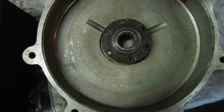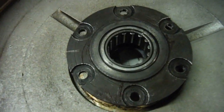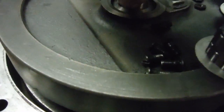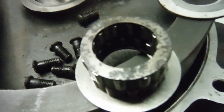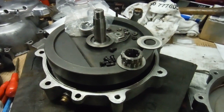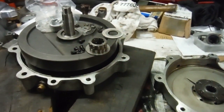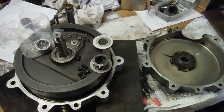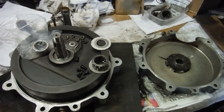So a full lubrication potential for the big ends will be maintained, and I'll have overcome the problem of not being able to get a very rare main bearing for the drive side of this engine. By putting something else inside it, the rollers will run direct on the main shaft, which is not ideal but is what would have happened originally. Bearing in mind the bike is 90 years old now, it will probably be a long time before anyone has to worry about the main bearing or the main shaft again. So I'm going to get everything ready to put together and hopefully fairly soon I'll have a complete bottom end ready to go back into the frame — another big step forward.